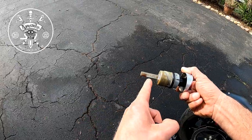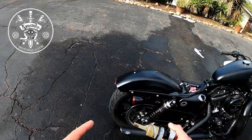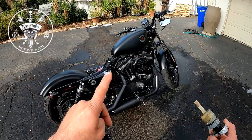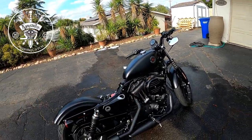You want it in between those two lines. It's looking a little low — I like to have it halfway. You do not want to overfill this. If you overfill this, you're going to have oil coming out the intake. I repeat, do not overfill this oil — you'll have oil coming out the intake. It's a big mess; you're going to have a bad time.